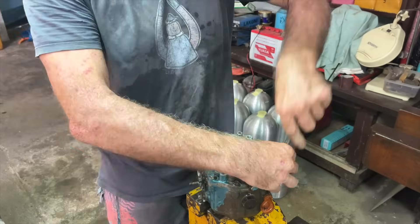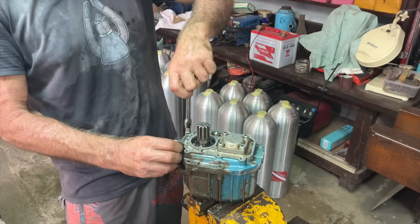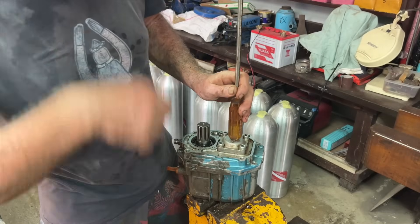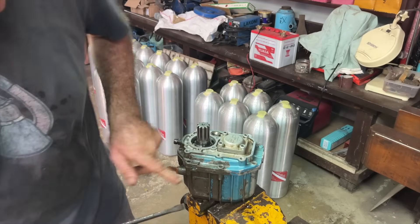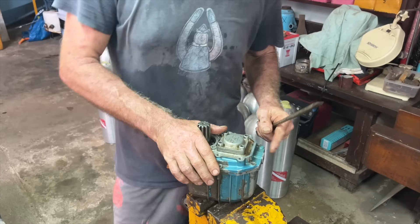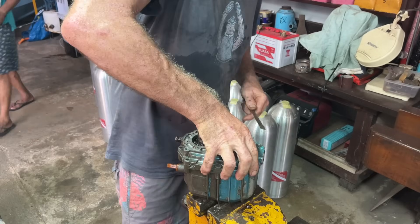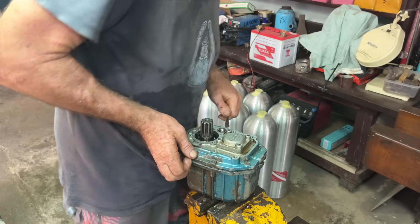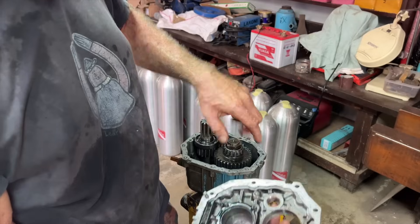Next up is the main end cap - this is how you split the housings on the gearbox. We've taken all the other bits off. I think there are eight or ten little 10mm screws around there - pop all them out. Get your big screwdriver again, and there are two little notches specifically for it. This one's got little splines built in so you can line it up when you reassemble, but that also makes it difficult to get off. Lever it off very carefully - don't damage the faces. Any dents in the faces will mean you're going to leak oil, so be careful.